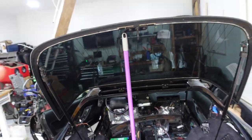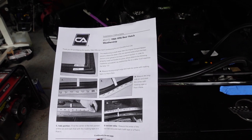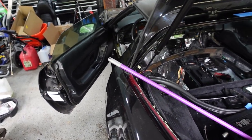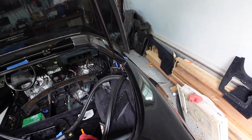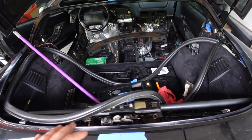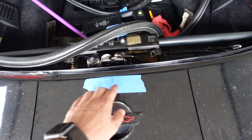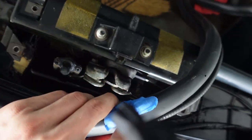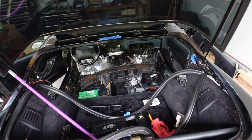I ended up following the instructions from Corvette America. They say this is a longer weather strip than the factory one to prevent the corner blow that they all have — that glue joint gets stressed and the strips pop out. It's really only glued in that one spot. I'll do a little bit of glue here and there, but mainly you need it in the corners. Since we're putting the corners in last it should have low tension. You basically want your center points marked on the frame — I have mine marked up there — and I marked center points on the strip with some tape. Line up the center points first, then work everything into the corners, and that way you should have minimal tension.